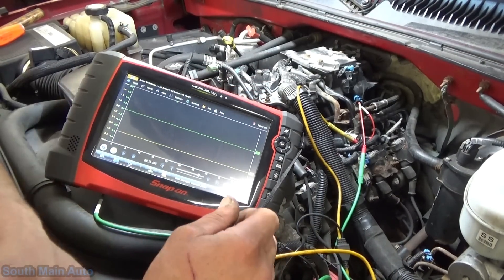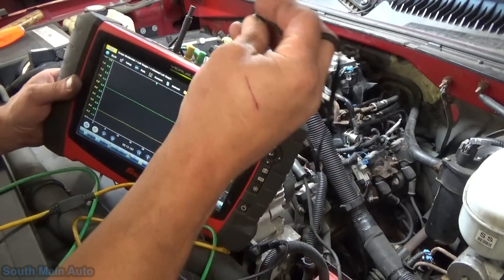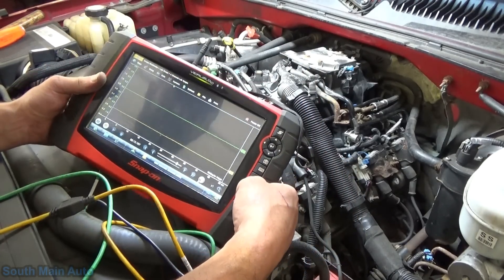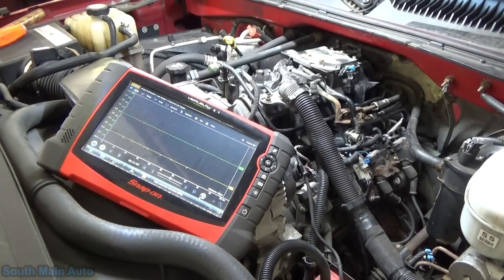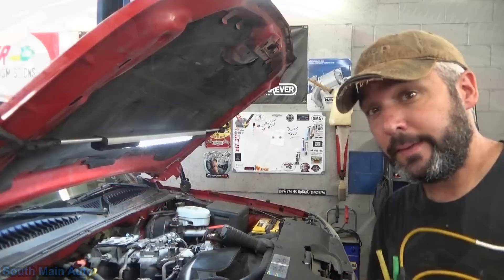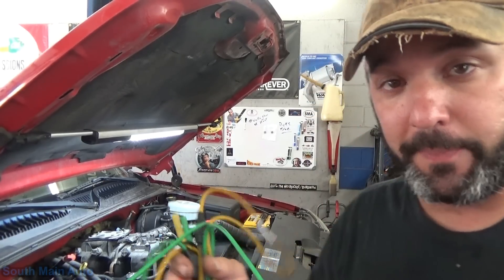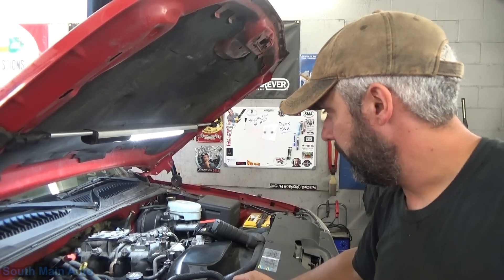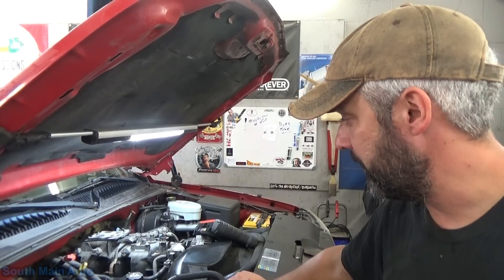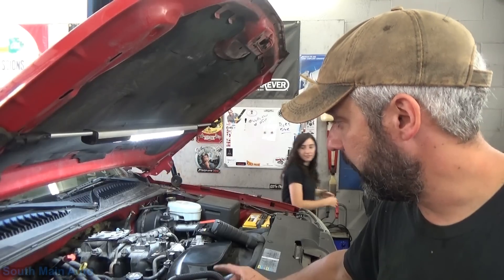On these, I've never seen anything other than just a knock sensor fail, so if you're in the market and take a wild guess, you'll probably get it right. But as you guys know, we don't guess — we test. That way I don't get burned. The torque spec is about 15 foot-pounds or something. Just use your noodle — don't crush them down. Same thing with the intake: torque to spec.